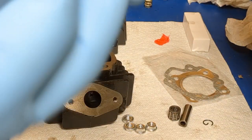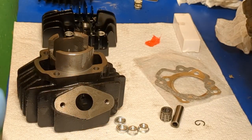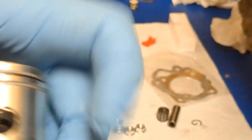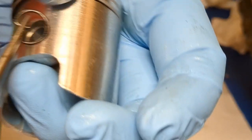And then from your exhaust side, you're going to want to put this on your left, so you're going to put it on this side over here. Try to throw one end in like that. I don't know how good I'm going to be able to get this on camera. And then feed the other one in with your pliers. So I'm going to hold the one end into the groove like this, and then grab my pliers and force it, like so. Force the twist into it.